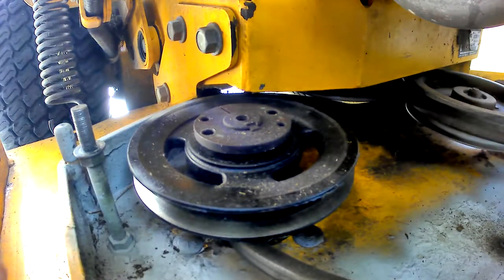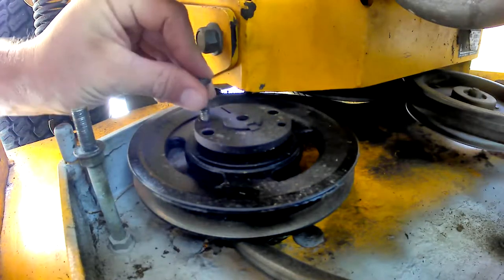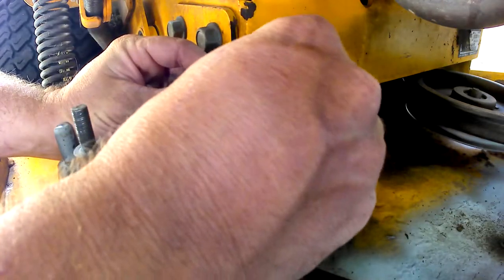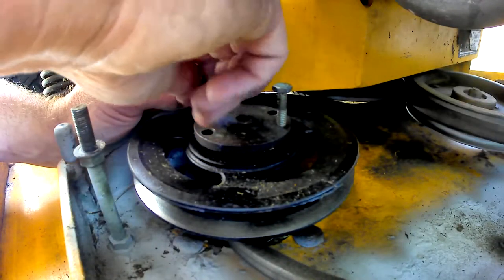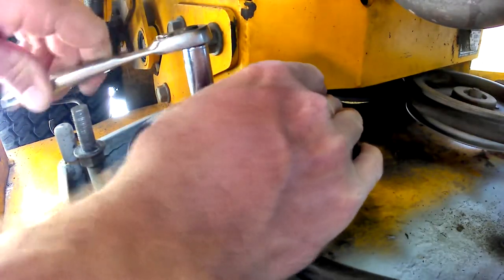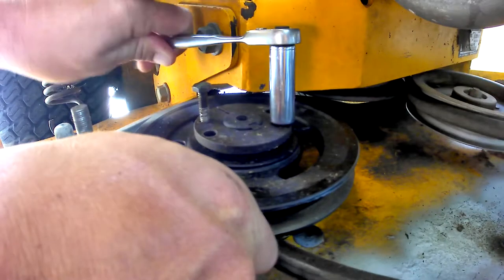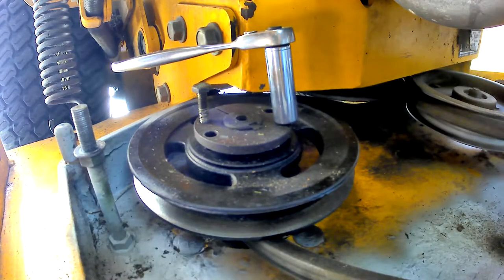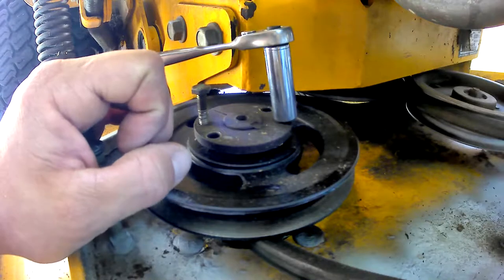You'll take these two bolts that go through these sleeve holes and screw them in right over on the threaded portion. These bolts are 9/16th - went ahead and got a deep well quarter-inch drive socket. Make sure they start here; we'll probably end up getting a crowbar to hold that in place as they go in farther and drop the pulley.